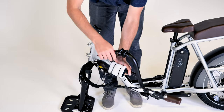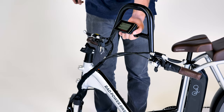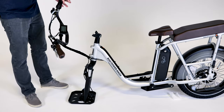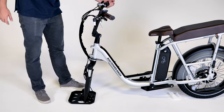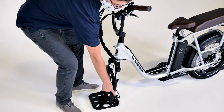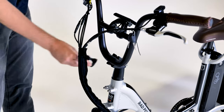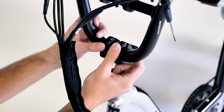Set the faceplate near the bike for installation. Leave the keys zip tied to the handlebar until you're ready to ride. Orient the handlebar so the brake levers face forward and the three-button remote is on the rider's left side. Trace the brake cable from the left brake lever to the brake caliper and make sure the bundle of cables is not twisted.